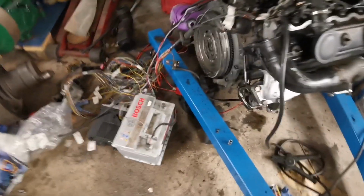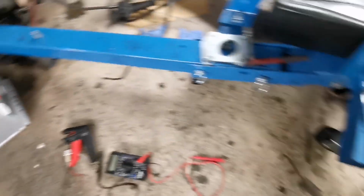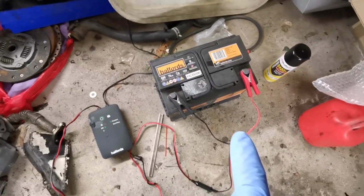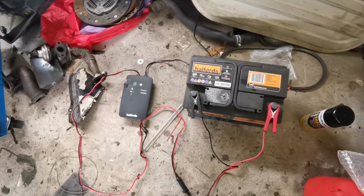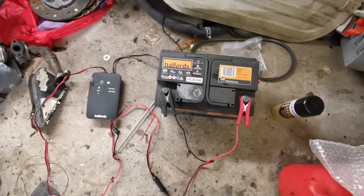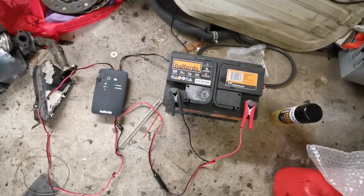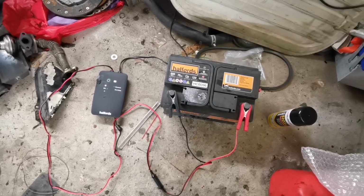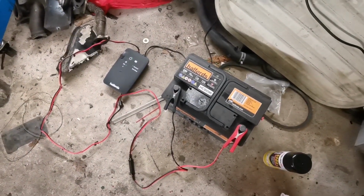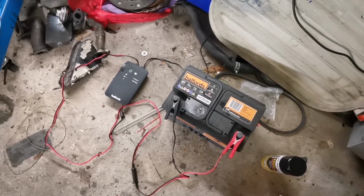So basically, first of all, there is the battery I have been using to try and start it, and over here is the battery I will be using to start it. More cranking amps. And what I'm going to do is I'll see how this cranks over on its own. And if it doesn't, you'd swear I'm sponsored by Halfords here at the moment, but I'm most certainly not. If I am not happy with how much power that battery is providing on its own, I will connect the two batteries together in parallel, and that gives me more power. So we can maybe look at doing that.